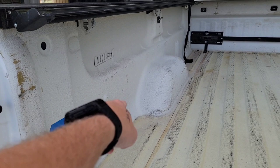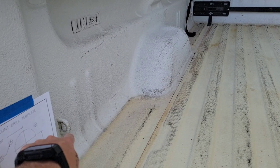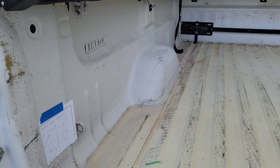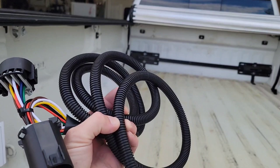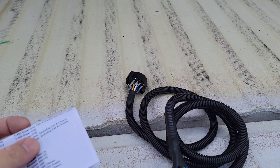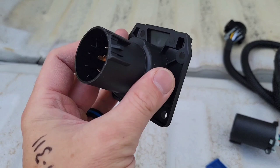This is where I'm going to put it on the Chevy. I've seen them up there. As long as you have clearance, you can put it wherever you'd like. I try not to put this down where you're going to have a tie point going across it. Right here I didn't want to do there just because it's really low to the bed and that's really far to try and reach. So we're going to put it right there. I'll put a link in the description to the 7-pin. You can buy an $80 Curt one, a $100 one from GM, or the $40 one from Amazon — it's irrelevant. Here's our spec sheet saying it's good on all of those. We'll test it later.